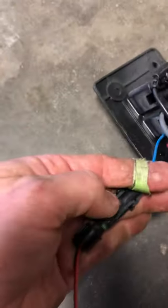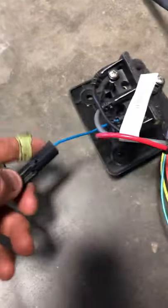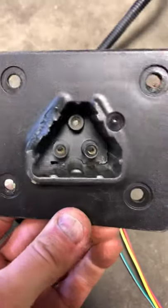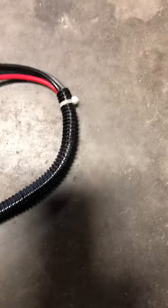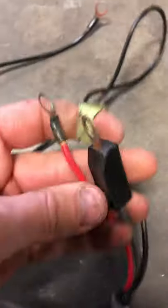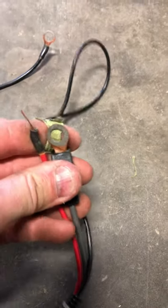Right past that you have an orange plug, which connects to the blue wire out the back of the charging port if you're using a triangle-shaped Delta Q charger. This is your charger lockout. The three wires from the charge port: the black wire goes to ground, and the two remaining wires — red and gray — both go to the hot side of the 48-volt battery.